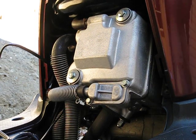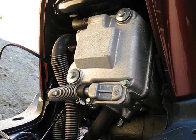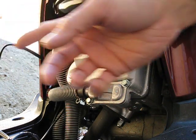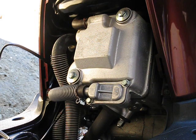This is a how-to valve adjustment on a Honda SH 150i, a 2010 model. Take off the engine cover, take your spark plug out, and take off your variator cover or drive cover. That way you can spin the crank.